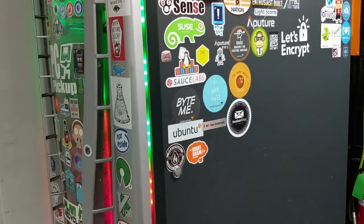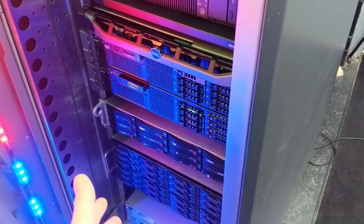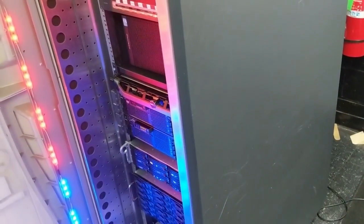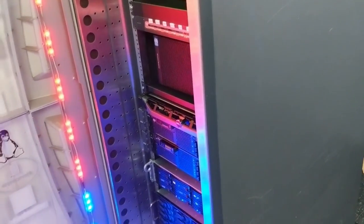That's why all these drives, and I will comment on this real quick, everything has a password on boot. All these FreeNAS drives will not decrypt without the password. That way, anytime anything starts, you have to have the password. So if you were to somehow take all this with you somewhere else, nothing would boot. You do have to physically type passwords in these to get them. It's inconvenient to reboot remotely, I get it, but on the other side is security.